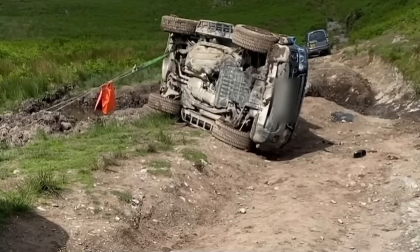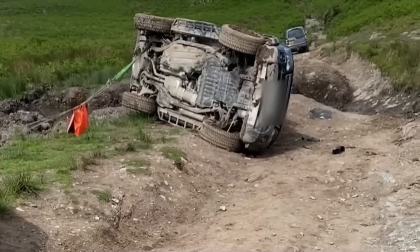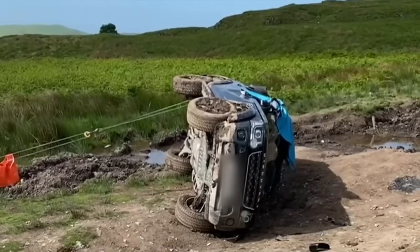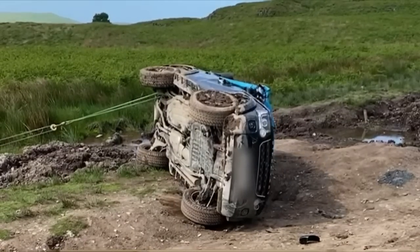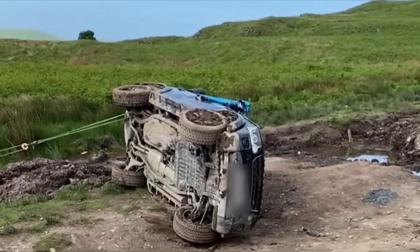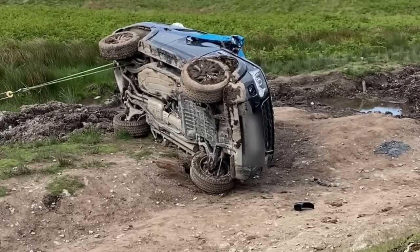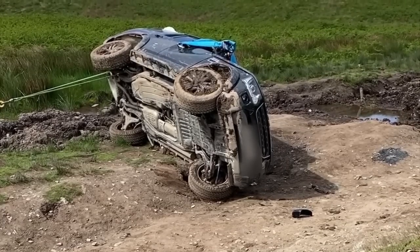I'll give an explanation of how we actually rolled the disco later in the video. From here we moved the strap to the forward-most leg of the lower suspension arm to get the pull more central. We couldn't get the strap around the chassis because of the fuel tank, and we couldn't get it around the body mount. We used a snatch ring and a soft shackle attached to the strap to double the power of the winch while slowing it down, providing a nice controlled pull. We placed a winch blanket over the line close to the snatch ring in case anything went wrong. The winch fitted on my disco is a Warn Zeon 12S Platinum with a 12,000 pound rating — plenty enough for the job.